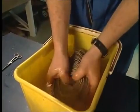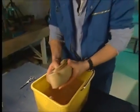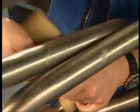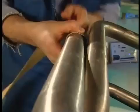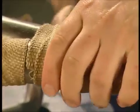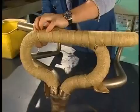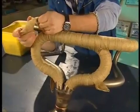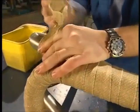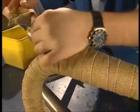Just a little job I have to do is to put on heat wrap — which is this stuff — onto the exhaust, which is this bit. The point of doing this is that a lot of heat is going to be generated by this exhaust, and covering it in heat wrap just protects those more delicate parts of the engine compartment. At times like this, years of plaster casting animals with broken legs comes in very handy. It's best to take your time with this to get it right, but it's actually a very satisfying job. We're nearly at the point where this is finished. It will take three or four days to dry out — if you want it to take a little less time, the thing to do is take it into the warm, shift grandma out from in front of the fire, and put it in her place. When it's dry, it gets painted with fireproof paint to stop any oil or anything getting stuck in it, which could be a fire hazard, and then it can get fitted.